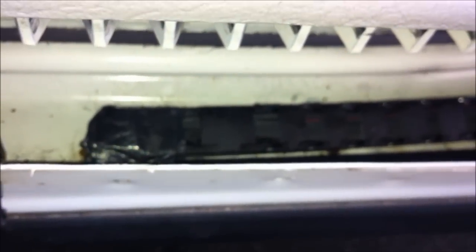The next step is to take the chain link right here on each side. The easiest way is to take a flat screwdriver, put it in between here, and pop the little tongue out — you can see the little tongue right there. Do it nice and easy. Do another one right here. Once you pop those two tongues, it releases the chain, making it a little easier to work with.